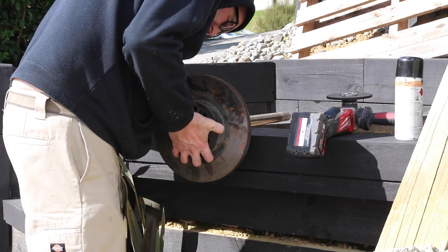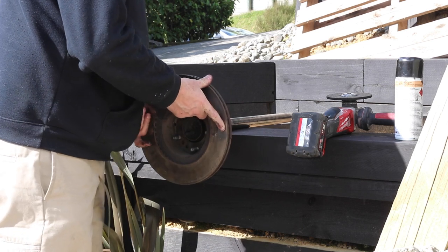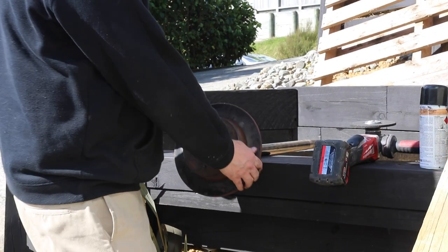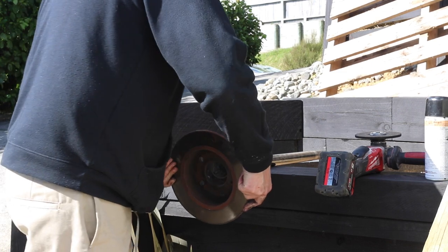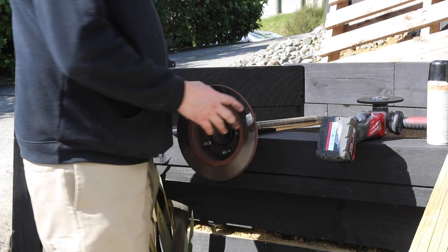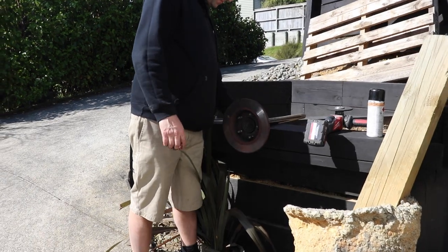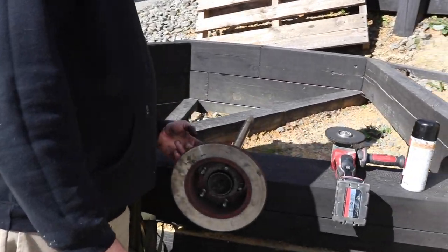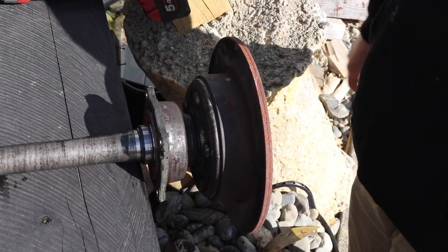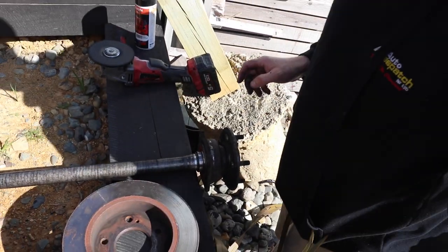How many discs would you have, Blair? Oh, this is the front FC ones. They said it might be the front FD one. Oh, that looks a bit better — and they're not cross-drilled. Multi-stud. See the difference here? The hat is like five mil bigger the whole way around. Those other discs that you gave me were narrower than that — so we were going to have to take like five mil off the whole way around. I'd be here all day, mate. The disc would not do it.